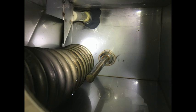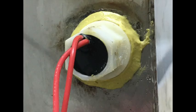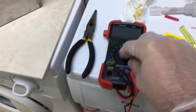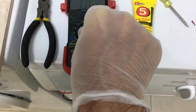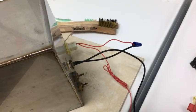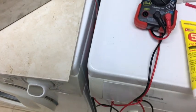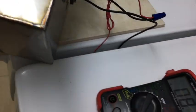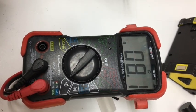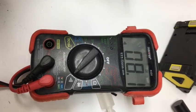I filled it with water to test for leaks and noticed there was no leak at all. Then I tested connectivity of both the float switch and the thermocouple. The thermocouple we can't fully test, but the float switch is now reading 8 ohms as opposed to 40 ohms, so maybe that's okay. We're going to test the unit next.